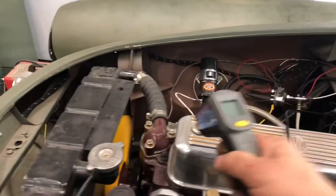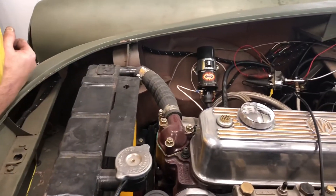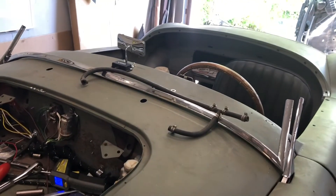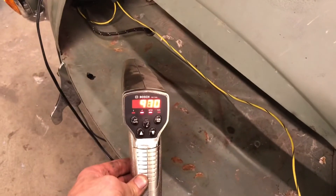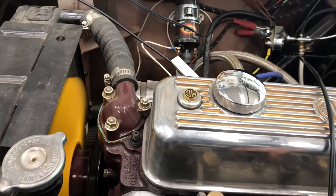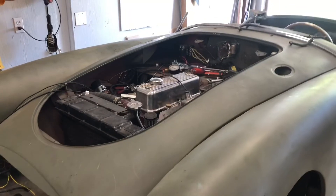It's only holding about 160 degrees, which is really surprising. The car ought to give pretty decent performance since it is an MGA with no heater, cut-down windshield, and nothing extra on it. I've set the timing to about 33 degrees total timing, got it sitting there running at about 950 RPM, and totaling about 50 pounds of oil pressure at idle. Got the carburetor pretty close. That sounds pretty good — good enough for him to go put the miles on it.